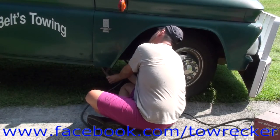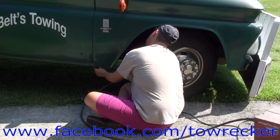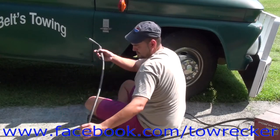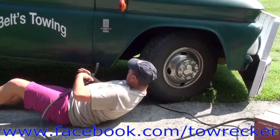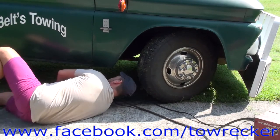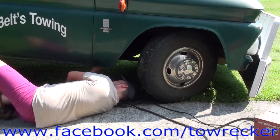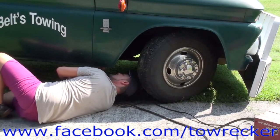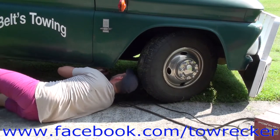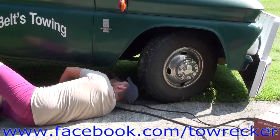There's another piece back in here that is part of this brace system that is loose. We're going to try to put a tack on it if it's at all possible. It's kindly rotten. Because all this original brace is trash, it's all there is to it. But I've got a good set of fenders, it's got it all on it, so see if we can do anything with it. It's actually the back brace, the back apron brace of the fender. But I don't want to weld it to something that's going to cause a problem later. So I'm looking to see if I can do anything to weld it to, actually something that unbolts just to support it. Looks like I might can tack it right there. It's not going to do a whole lot, but you know, it's not really a problem.